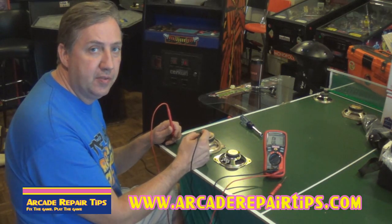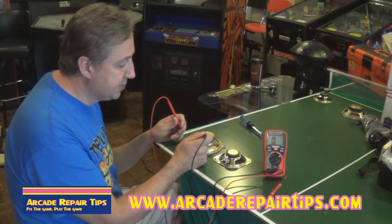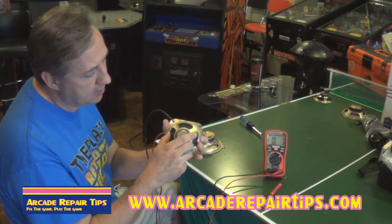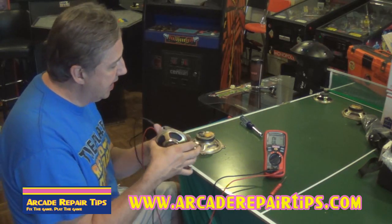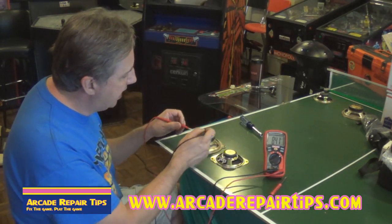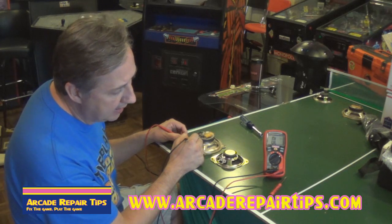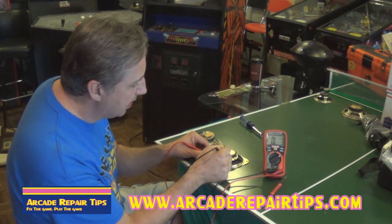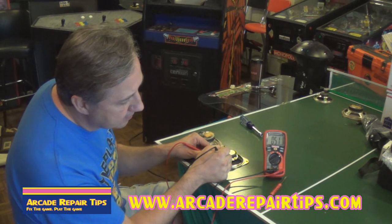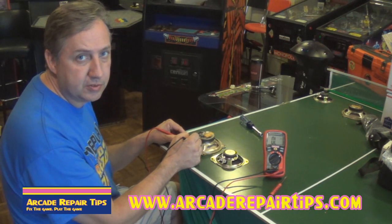We've taken the bad speaker out of the game, and here's a brand new speaker. We're going to check the ohms — the resistance — across it to see if the speaker is good. As you might notice, a lot of speakers will tell you their rating; this one says eight ohms, five watts. Ohms is that symbol that looks kind of like an upside-down horseshoe. We've got our meter set on ohms and we should be reading somewhere close to eight. The old speaker is just showing shorted — not reading anything. Watch when I test the new speaker: immediately it starts climbing up, and there we're at six ohms. It's a brand new speaker, so not quite eight, but we are reading something compared to the blown one that just shows a short.